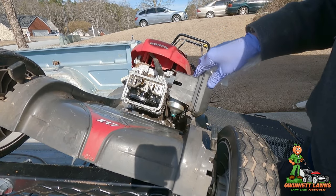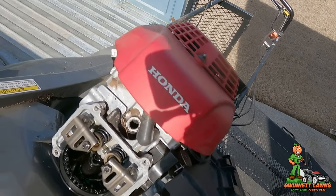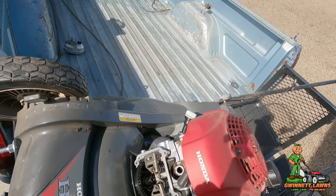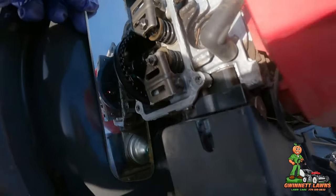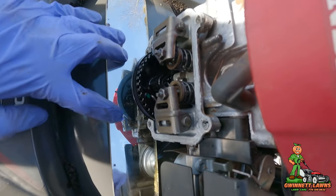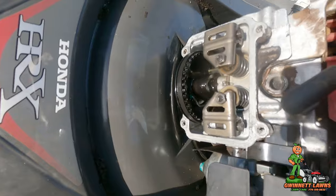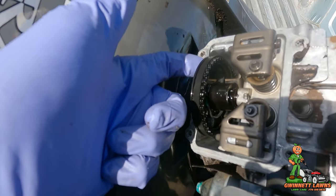I see another little problem here. I've got the piston at top dead center. The way you know the cam is at top dead center — you have to use a mirror. There are two hash marks on the underside of the cam, and those two hash marks run this way and this way and they line up with the edge right here.